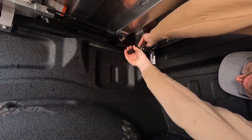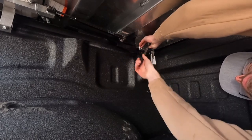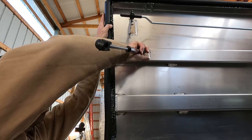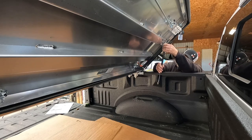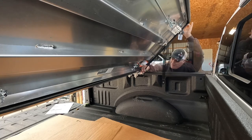So this is what I was talking about — having to crawl underneath there. My father-in-law is on the other side holding it down so I can get a nice tight fit. Now we're going to fast forward: we've got those locks all taken care of, and we're going to go ahead and put on these struts — gas springs. These gas springs are what's going to hold the panels up, making opening and closing so much easier.